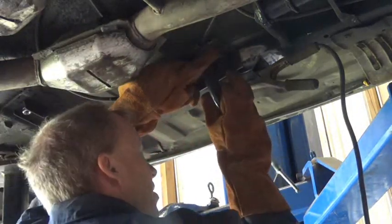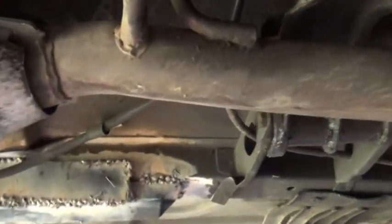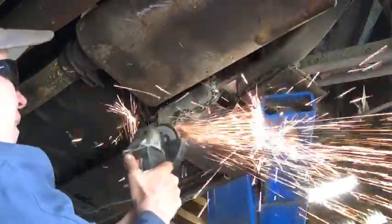These plates I made — I cut some little rectangles to help make it even stronger than just welding seams. I welded on those plates, used a clamp to hold them up. I am not a welder, as you can see — that is pitiful — but I got everything welded: top, bottom, sides, those plates. I welded the seams, then came back and re-welded the factory convertible plates to the bar to make that strong. They didn't reach all the way to the front, so I didn't have to do anything with those front plates. I also welded on the cross members and cleaned everything up.